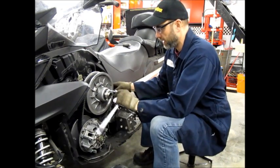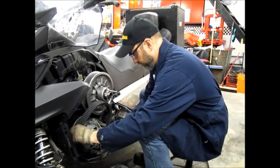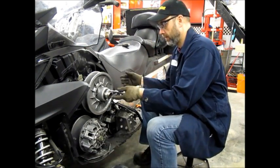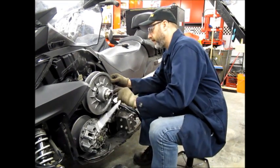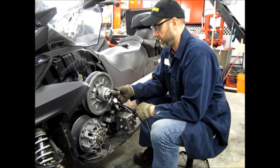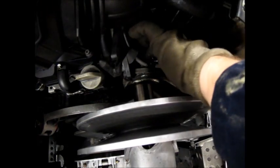I have a six millimeter bolt — you can use the Ski-Doo part for it — but I'll just open up the clutch here and slide off the belt. Take this off. The next part is to take the nut that holds the retaining ring for the bearing, take that off. Then we want to take off the retainer bolt back here — it's a 13 millimeter — loosen it, not tighten it.